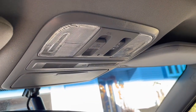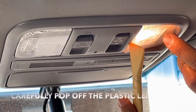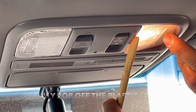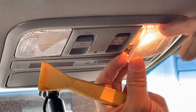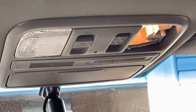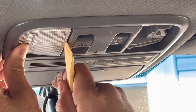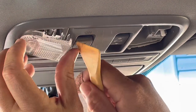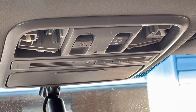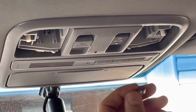So I'm going to open this up and see what's up. The way you pop these things is you take a little trim tool and pop it from here. So it pops on either side. So that's your bulb there. I just want to see if the bulbs are working. I'm going to switch them around.